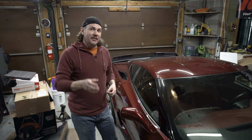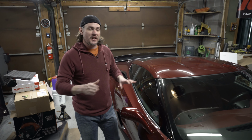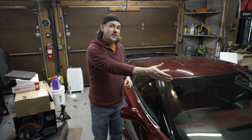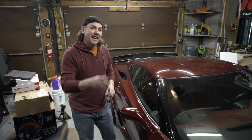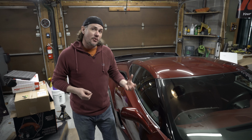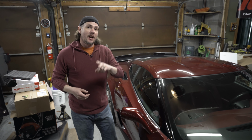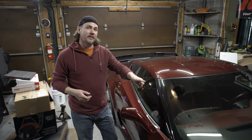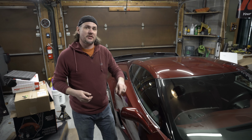and drop those out. Now there is a cross beam that's just an aluminum cross beam, at least on the Z06, that connects the frame to the subframe. On the passenger side, you'll want to go ahead and remove that. The driver side did not have the issue. Also, if you have a Z06 or a dry sump, go ahead and drain the oil out of the system, because you're going to have to remove the tank lines that go over to the bottom of the engine pan on the dry sump. You'll see what I'm talking about on the passenger side whenever you go to remove things or put things back in.